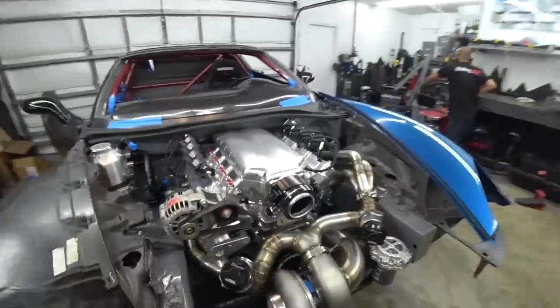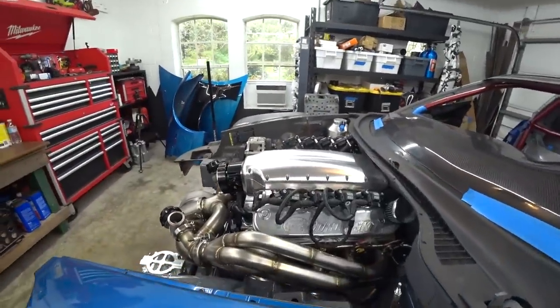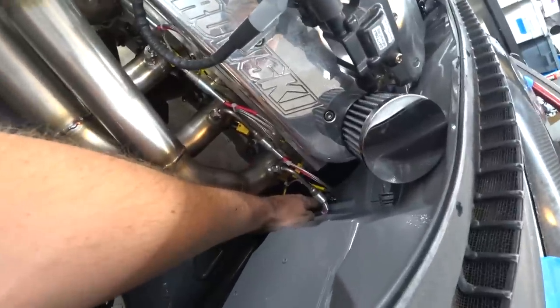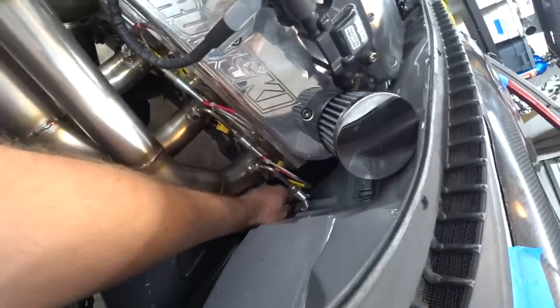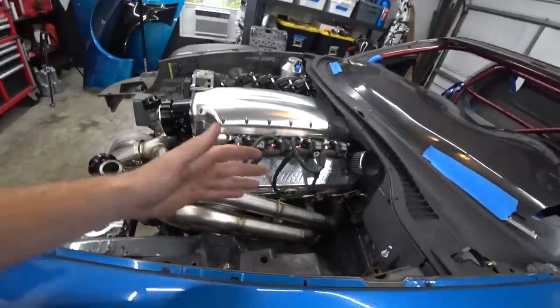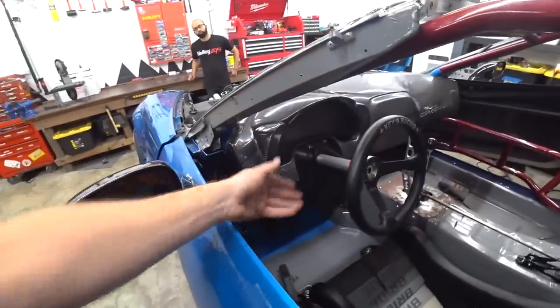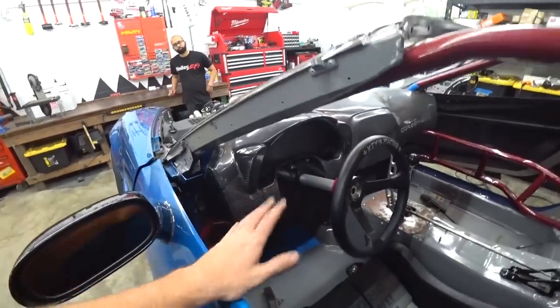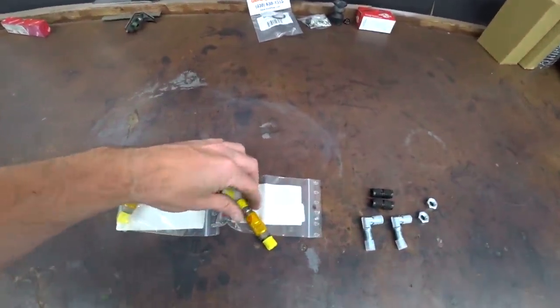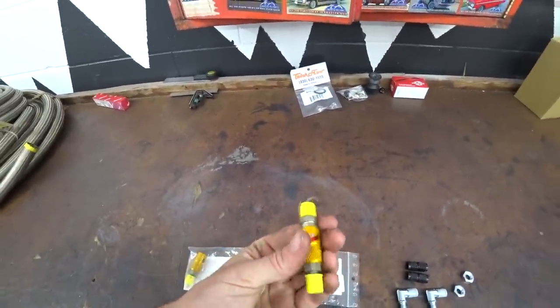Now we want to work on clutch lines. We have two lines coming out of the bell housing from the throwout bearing, and my idea was to bulkhead them with dry brakes. The problem is where these lines reach — it's pretty difficult to get to, making disconnecting the dry brake hard. We're thinking about routing them down low in the tunnel above the downpipe, since we'd have to pull the exhaust anyway to pull the bell housing, which is the only time we take those lines off.